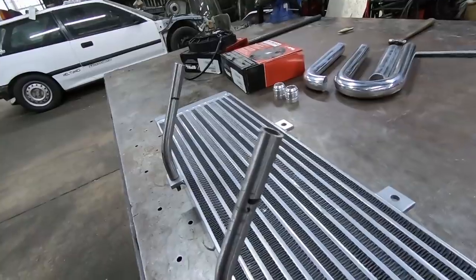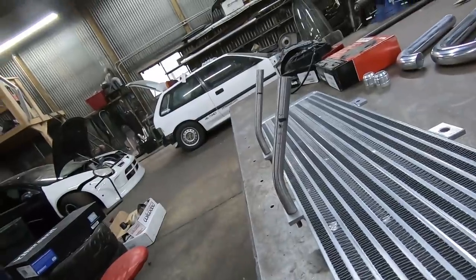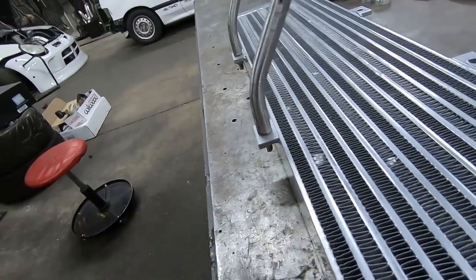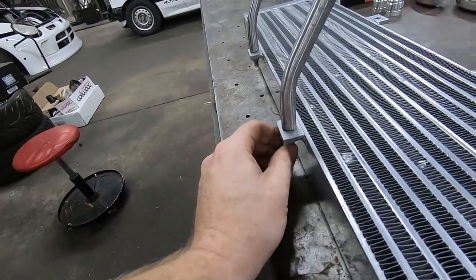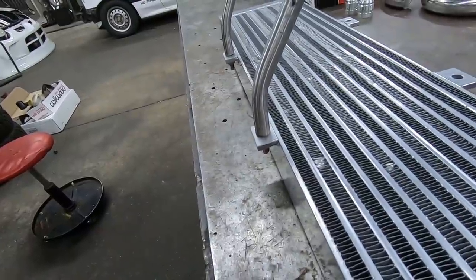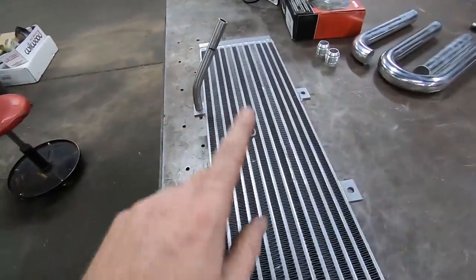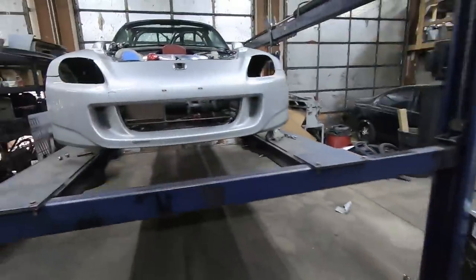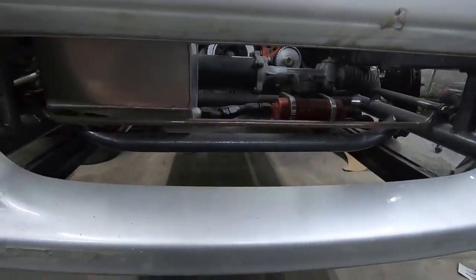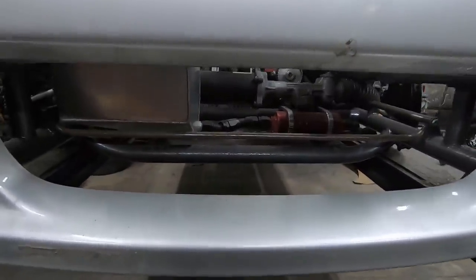I needed a little bit of a bend in them, so I put a bend in both pieces. On the end of these I took an allen head bolt - eight by 1.25 thread - sanded it down until it jammed in here, and pressed them into both of them. I'm also going to weld those as well, but I'll do that when I do final welding. These just need a notch now and we'll mount them to that crossbar. We'll get some notching done, tack this on, get the lower mounts all situated, and then figure out what we're going to do on top.